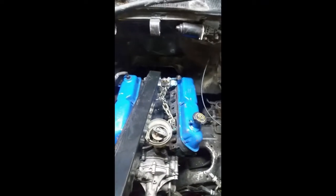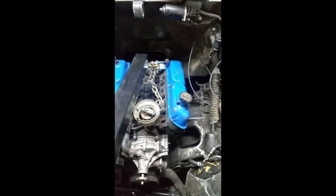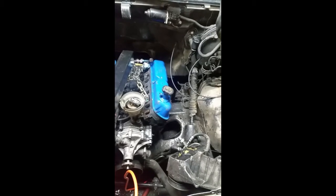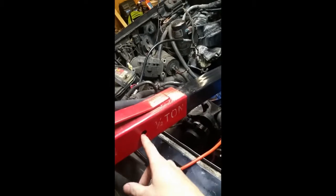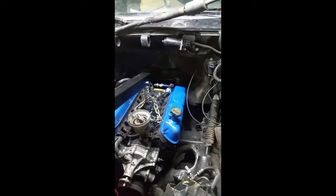So me and Ryan worked for, would you say, more than an hour or a couple hours, just trying to force the engine back into the transmission. Any tips for that, Ryan? Seemed like we maybe jacked up the transmission and started trying to stick it in at a higher point, where it helped line up better, because we'd like to have one of those pieces for a hoist where you can lean the engine, but we don't have that. And then the hoist wasn't long enough, it was bumping against the truck bumper, so we decided to take this out and risk it and slide this forward a little bit so we can get a little farther back. We got the top two bolts in to get it initially in, and then